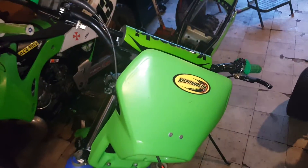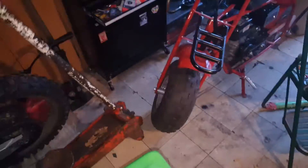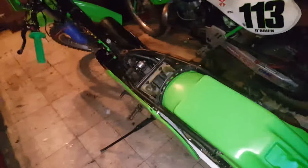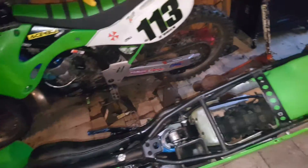A lot of people say it's difficult to convert from 6 volts to 12 volts — that would be true if this had a battery. This bike isn't the international version; it never had a battery, never had signal lights — it was all 6 volts only through light filaments and resistance. One front headlight bulb, which would be 35 or 25 watt 6-volt, if that blows, the tail light would flash and blow as well, because they're running off resistance instead of actual current. With both lights working, the resistance is equal, it cancels out, and it works off the stator which produces about 30 watts.